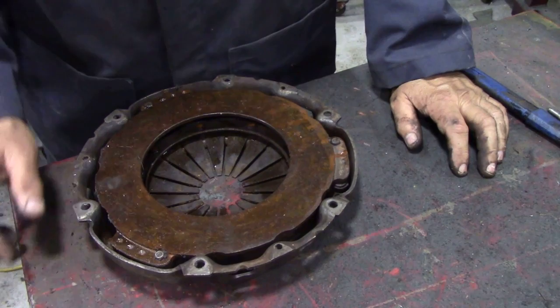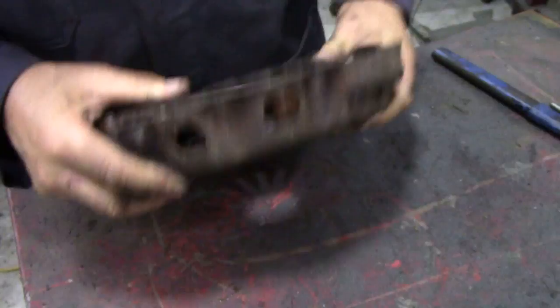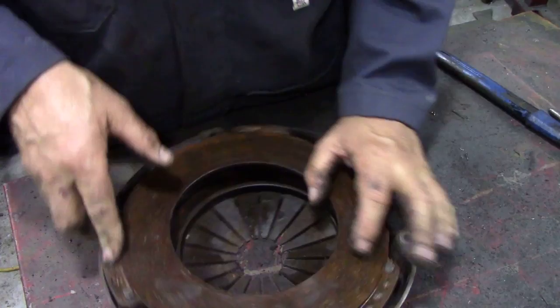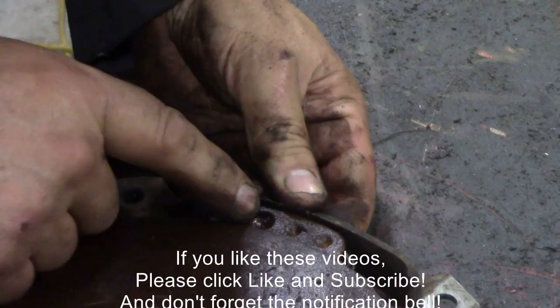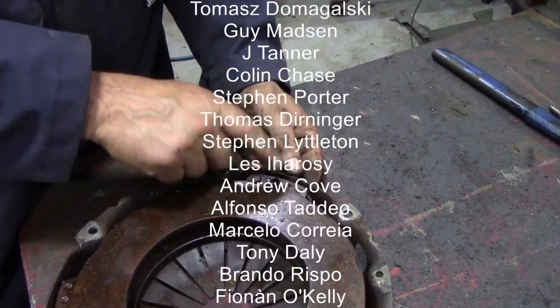Another thing to notice, something really interesting — balance points. A clutch is balanced before leaving the factory. I can see no obvious balance points on the outside of the casing, but I can see here, if you can zoom in, this is where the clutch has been balanced. See these little dimples? They've got some primary dimples in, and they've put some more dimples in here. This one has been drilled a little bit deeper, and the reason for that is there must have been more weight on this side, so they've taken some weight out. It's quite interesting. In the old days, what they used to do is clip or weld a little piece on the outside of the clutch, but now they do it like that.